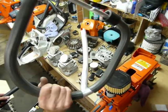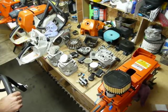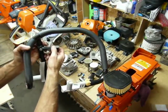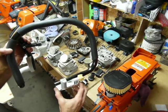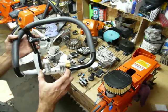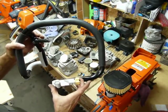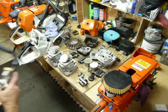With five bolts, this thing falls off in your hand, which is sweet. If you look at the 661, they actually have a forward cant compared to the 660, which is nice. They're spring-mounted now, the 661. They have this little apparatus in the front which holds the front spring mount, and a little foam piece — we'll look at the cases in a second. Two bolts run parallel with the line of the tank, a little bit more separated, probably a little bit stronger, but as a word to the wise: don't bend these. You won't like replacing them — it's a pain in the rear.